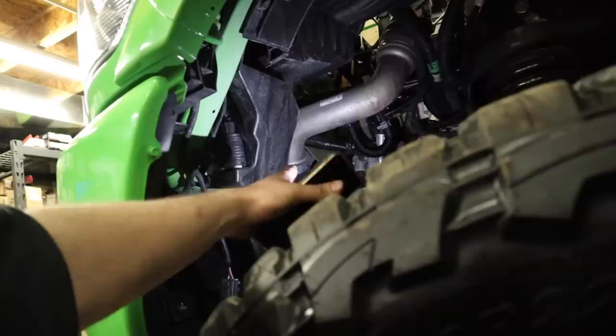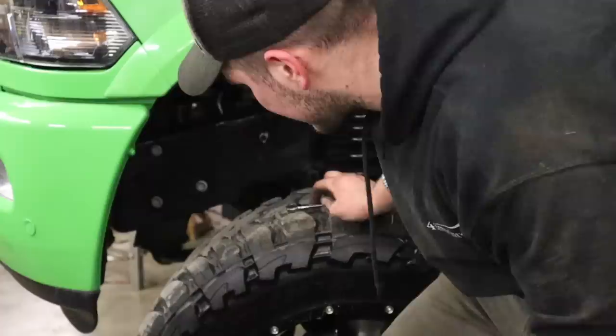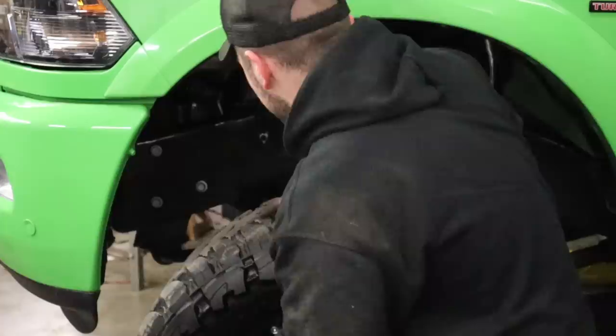There is the factory boost tube, and if you take the wheel liner out, it's right in your face — easy access, no problem at all. We're gonna loosen the clamp on the bottom boot and stick the driver-side boost tube in, then attach the intake horn. I loosened that with an 11 mil at some awkward angles to get that clamp done. Going to yank it out — using a pry bar to nudge that boot loose, and then the pipe should just slip off.